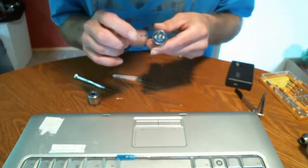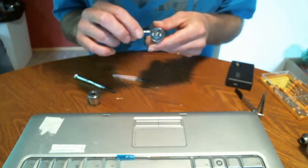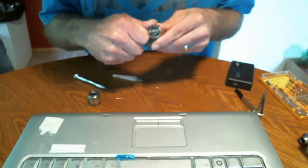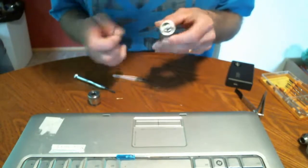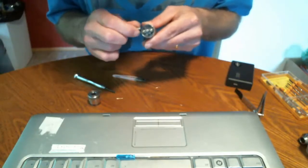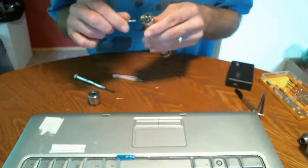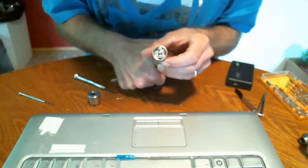Now slide the same screwdriver that you made your coils with through the coil. That aligns all them coils back. Straightens them back up. Give it a nice little pull just to tighten them back up. Straighten everything out. Do the same thing to this coil. Pull it just a tad. Straighten everything out. Now these coils should fire up.